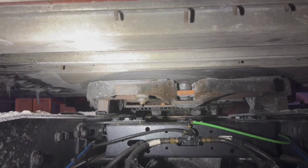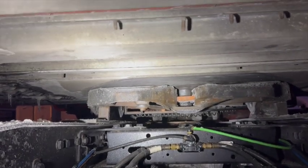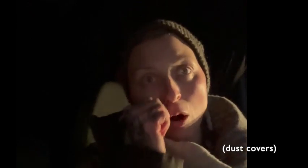I hope the brakes aren't frozen — and I shouldn't have said that out loud. As I attempted to pull out of the spot, I quickly discovered my tandems are frozen. I'm about to get out there with my hammer and try to get them unfrozen. What really stinks is that most of our trailers have brake covers, so it's very hard to hammer on the brakes. It's like this company is based in a constantly snowy and icy state and they have covers that make it very difficult to unfreeze your brakes.